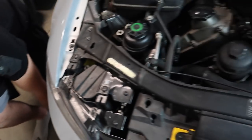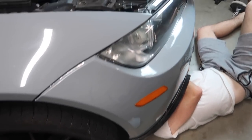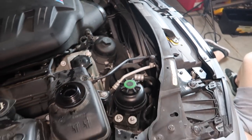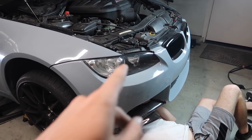We put in a little more water — about half a bottle — and it's already spilling and leaking. I need a light to see. It looks like it might be the radiator, not just the fan. We need to see if the radiator was punctured or just blew, so we need to replace the fan anyway and investigate further.